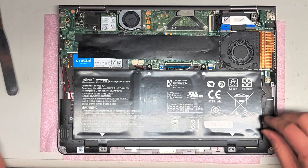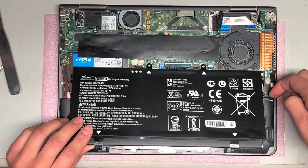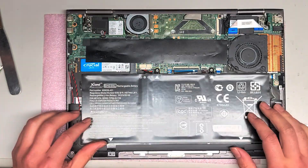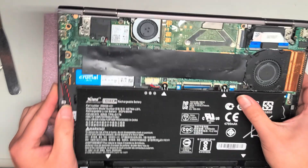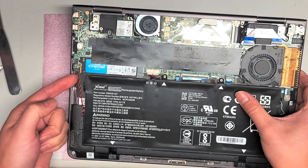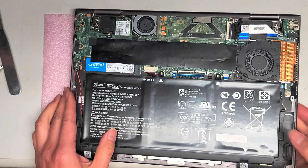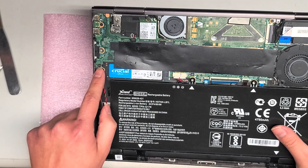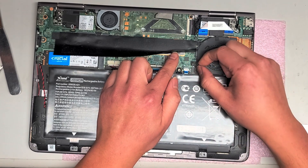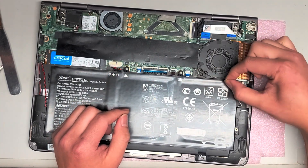I'm going to do a quick look underneath to see what's there. The speaker is held in place with another screw, but I'm just going to look under. This is the CMOS battery — the connector comes out by pulling it straight up from the tail. The CMOS battery keeps the BIOS settings. The speaker connector pops up from the tail the same way. The other speaker has a larger connector but only uses two pins — also pops up. The fan connector you grab and wiggle and pull back.